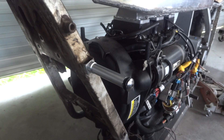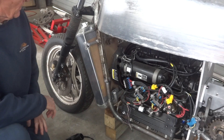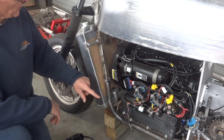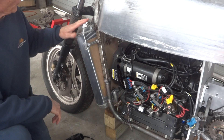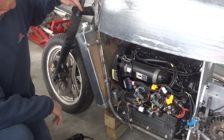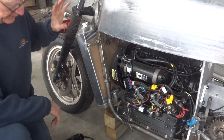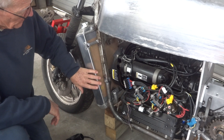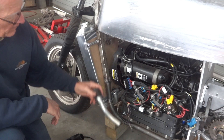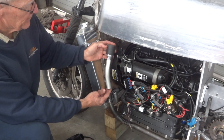And there it is, screwed into the frame. Our radiator's now got the top mounts in place; bottom mounts we'll deal with later. Unfortunately on full lock, the steering bottom triple clamp hits the radiator cap, so I have to move that — which is a nuisance, but we can deal with that. There's the radiator getting water out to the water pump — just a bit of sand-bent aluminium pipe.